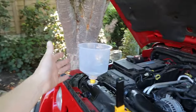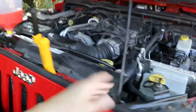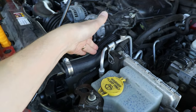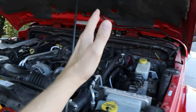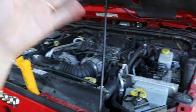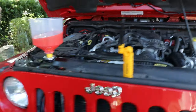The last hose that should get warm is this one right here, and that's after the engine's warmed up, the thermostat opens and allows coolant to flow through here. I was getting some good bubbles — it just sucked that down, so I had to fill that up. As our engine's cooling down, it's going to suck some of this fluid back in. As the thermostat opens, it allows fluid to flow through here. This hose stayed cold the entire time. I had my wife hop in and get the engine up around 2,000–2,500 RPMs. Let it warm up real good. I started to get the temperature gauge moving up to the high end, starting to overheat.